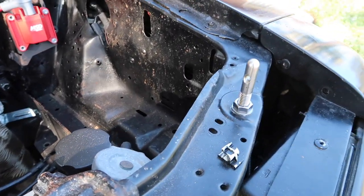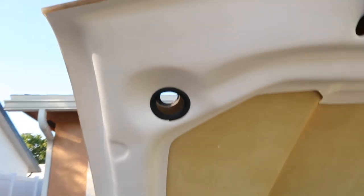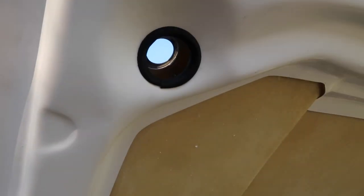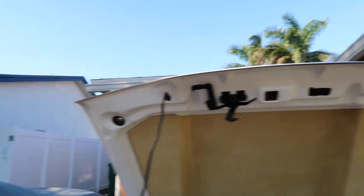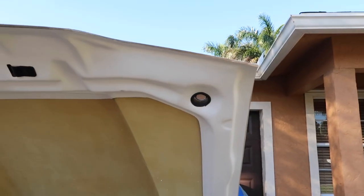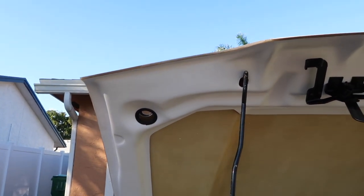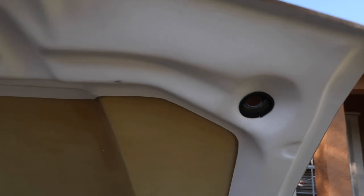I've taken my measurements and adjusted my pins accordingly. Another quick tip: something I like to do is cut up a little bit of vacuum hose and wrap it around the bottom layer of the hood — the hole that you cut on the bottom layer. It just cleans up the final result tremendously. It takes a little bit of time — cut up some hose, slice it down the middle, and wrap it around the lip of the lower half of the hood.